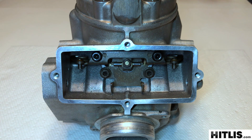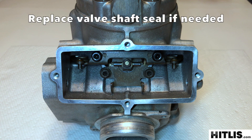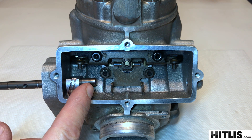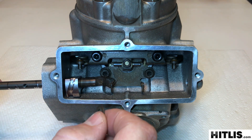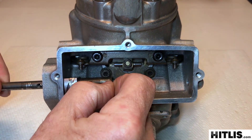Here you'll notice the linkage for the secondary valves. We replaced those JIS screws with the shouldered allen screws that come in the kit — it's just a way better deal. While you're at this point, it's also a good idea to put in a new valve shaft seal. First you're going to slide the valve shaft in partway, grab the red right pulley, slide it over the valve shaft, and push the shaft in about like so. Then grab one of the long springs and put it right over the shaft.